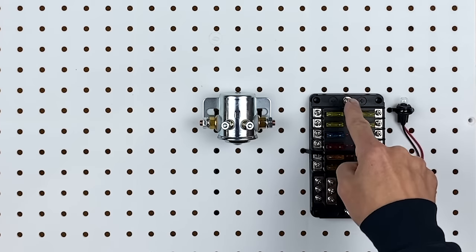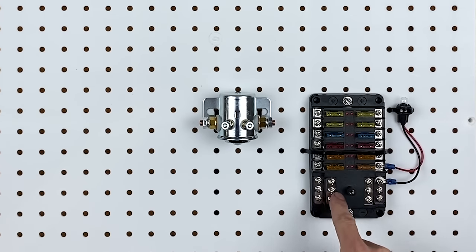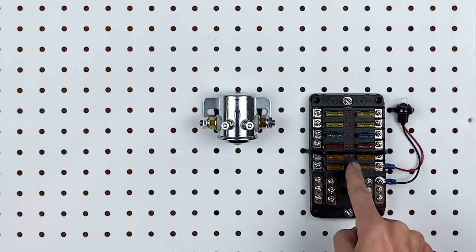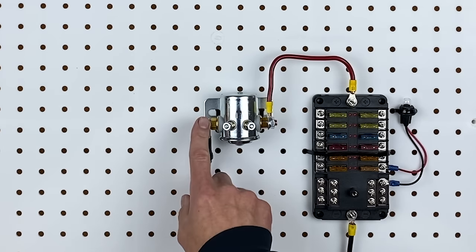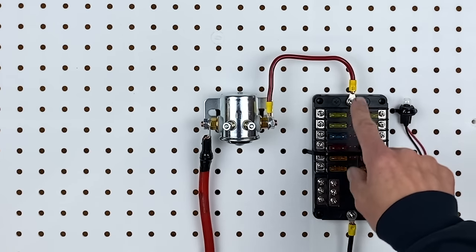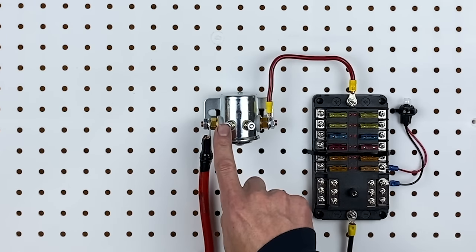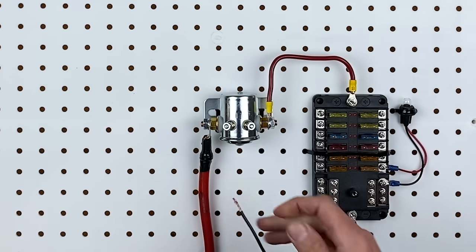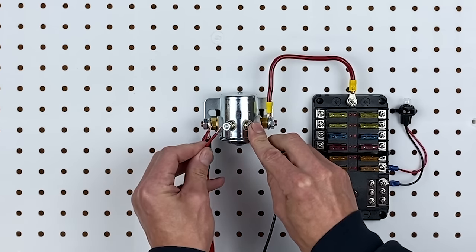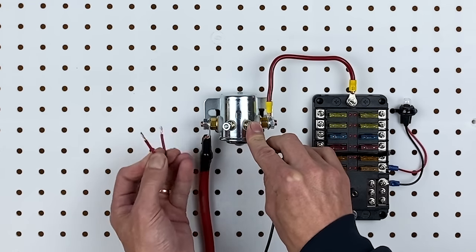We're going to have power coming off this side over to the positive terminal on the fuse panel. This panel also has a ground section — when you ground this, all of these become grounded down here, and that will allow our bulb to have power coming from the fuses and ground coming from these terminals. We now have some wires attached: the main battery coming in here attaching to the solenoid on the left, power coming out of the solenoid going to our fuse panel, and then we have the ground. I'm going to prove it to you with a couple of jumper wires — adding a ground wire to this terminal and a power wire to this terminal, turning on the solenoid which will power up the fuse panel which will turn on our light bulb. Ta-da! The solenoid is now turned on and powering up the whole fuse panel, and as soon as we disconnect the power from it the whole fuse panel goes dead.